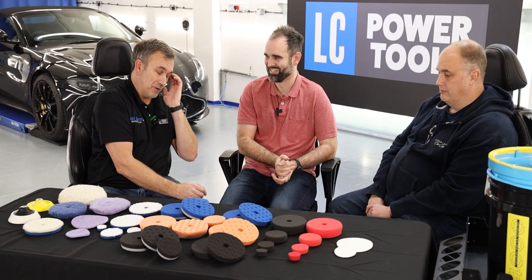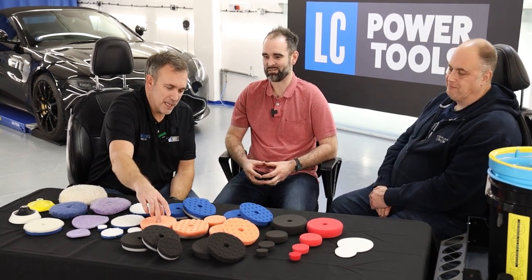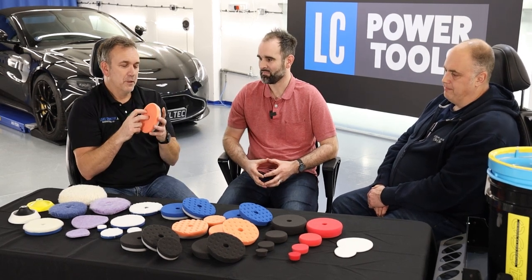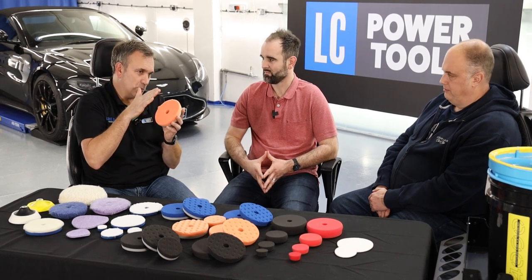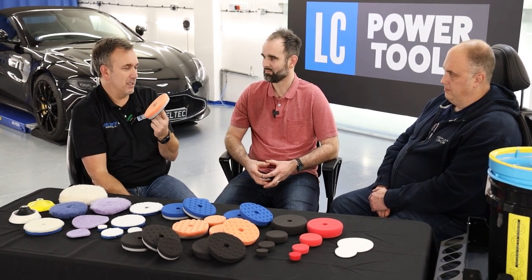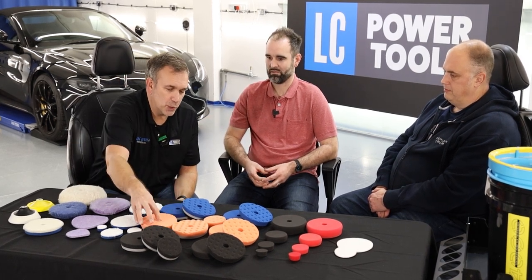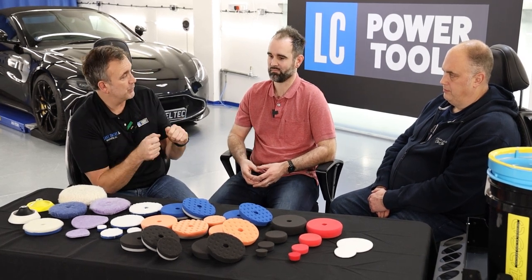I don't actually know the costs, and I won't ask John because he might not know the difference between an SDO and HDO. Obviously there's more manufacturing process in the SDO than the HDO. It's a more robust, durable pad that's going to take more violent action. If you're going to buy one pad, I would always just say the HDO, because that will work better over every single pad or orbit size than an SDO would. The SDO, if you started putting on a 21 mil orbit and you really were to turn the speed up and push, you're asking slightly more from that.